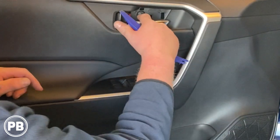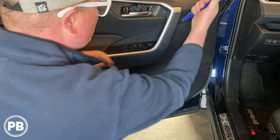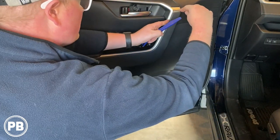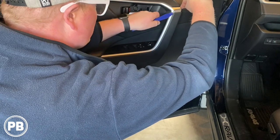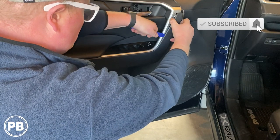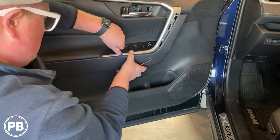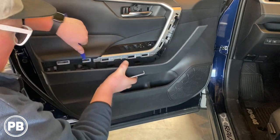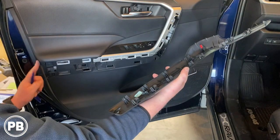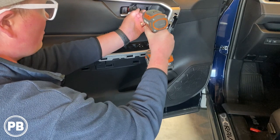There's just a little cover that covers this little Phillips. Then using your panel tool, kind of get up in here — maybe get started — and you get your little pick tool in there just to get a little bite on it. Then we will slowly pop this on out, just like so. Now, there is a little hook on this end, so keep that in mind. You've got to start from the top to make this work. Once those are all removed, go ahead and do the three screws.